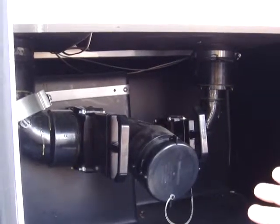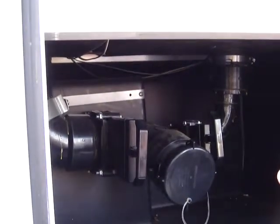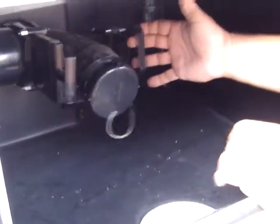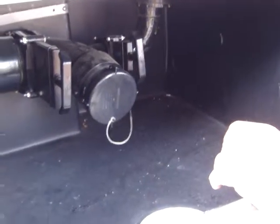When you get to your campground and you've got your sewer hose hooked up and in the ground, while you're camping you leave the gray one open — there's no reason to keep all that on board, so you just let it flow right out. Your black tank you leave closed because you're putting chemicals in the commode, like the liquids or the packs — you want to put a couple of those in there every time you use it.